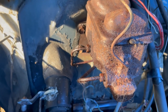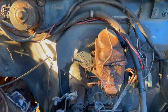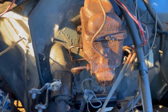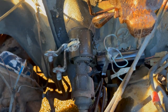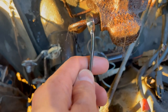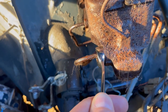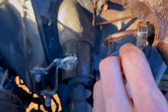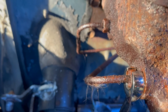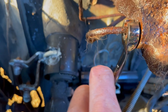I've let the lines on the master cylinder sit overnight with mystery oil on them. I'm going to see what happens when I try to loosen them up. You have to use a flare wrench on these because they round over real easy. It's loose, but the whole line is spinning. I don't know if you can see that on camera, but when I put this on, see how the whole thing's spinning - that's not good.